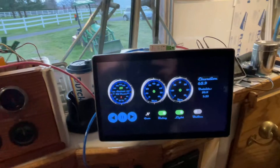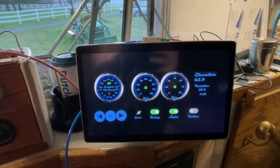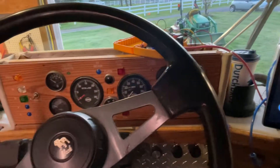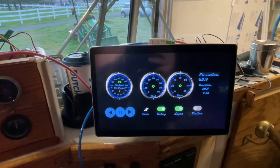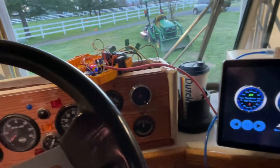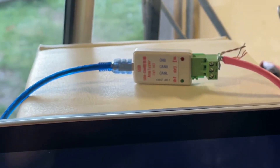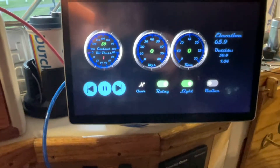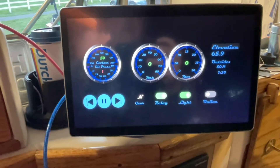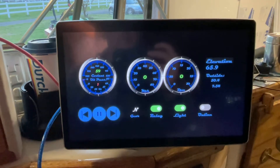The improvement I've been working on recently is the addition of CAN bus support. CAN bus is a protocol used in modern cars for the ECU — the engine computer — to communicate with things like your instrument cluster or infotainment system. This removes the reliability issue I had with Wi-Fi. There's a CAN bus transceiver on here connected to this USB CAN bus transceiver that's plugged into the dash, and RealDash is picking up the signal from that unit. It's not dependent on Wi-Fi for engine data.